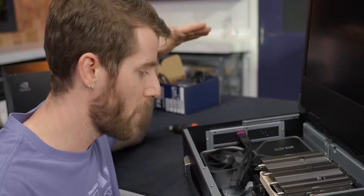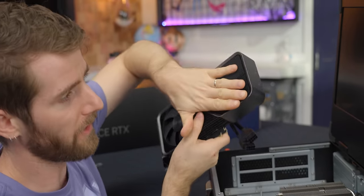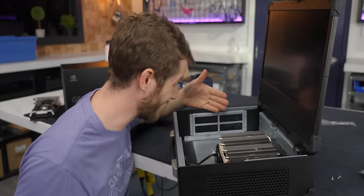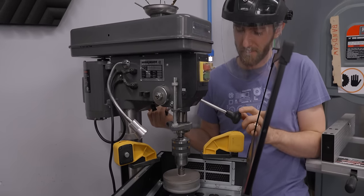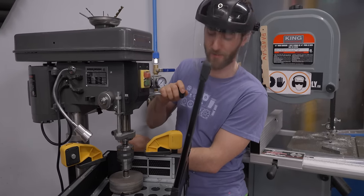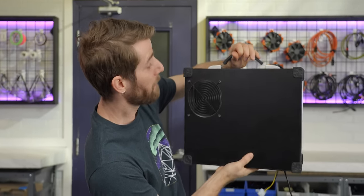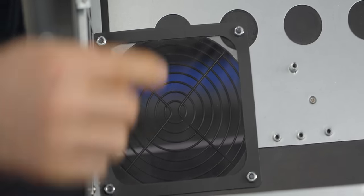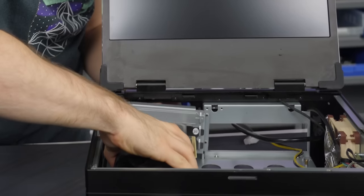We still have a problem: where is the GPU going to get airflow from? These pass-through cards suck air in one side and blow it right out the back — great for small form factor builds, assuming there's a natural airflow path through the card. In this case there is not. All we've got is this passive exhaust. Pain train's coming into the station. Four hours later — and four little holes, success! We've got a filtered intake to give our GPU much better access to fresh air.